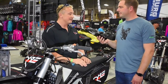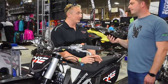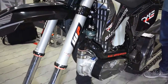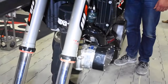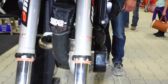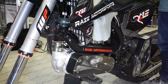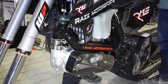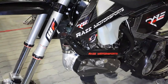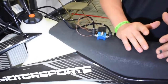We kind of scratched our whole turbo kit idea and went back to the drawing board. We do a lot of stuff in the jet ski world with superchargers, so we said let's get a pro charger on this thing. We spent all year doing the supercharger, and the thing that really makes this work is the electronics. We can still have full boost control through our ECU with the recirculation valve — we can command our valve in any position we want through a real dynamic table. We've got boost at idle, no lag, we can make a nice linear power curve, and it just almost feels electric when you ride it.